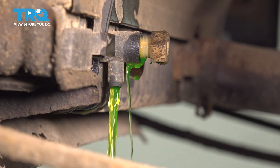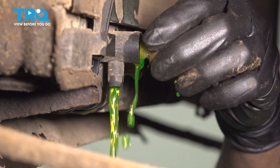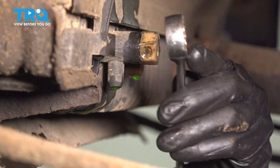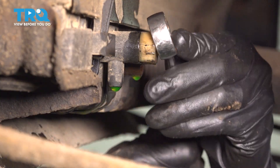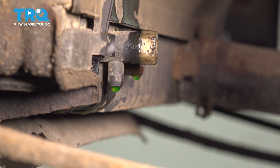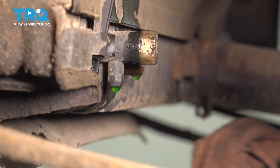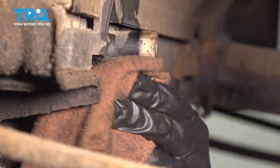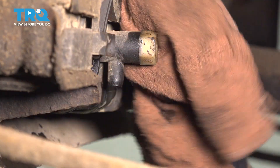This is about as much as I need to drain out of this radiator, so I'm going to plug it up and snug it down with that 19mm wrench or socket. It's bottomed out — a little bit extra is plenty. There's an o-ring in there that does the sealing, so you don't need to crush it down completely. If anything, doing that will break the plastic plug. Wipe it down so there's no more dripping of coolant.